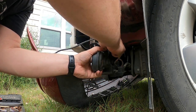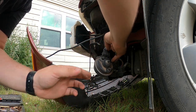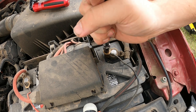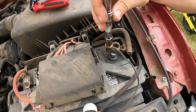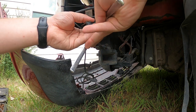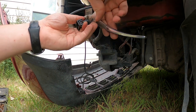I take off the old horn — the top one is the honking horn, the bottom one is the beeper for whenever you lock or unlock the car. I take the clip off, press the little tab, and pull the connector off. Then I disconnect the battery before doing the wiring work — it just makes it safer for splicing.